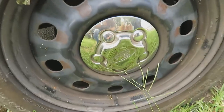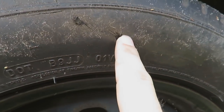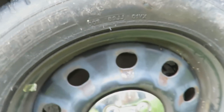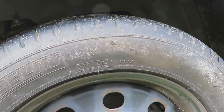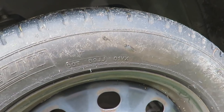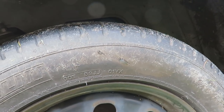Today I'll be popping these covers off. As you can see, there's some pretty healthy rust on these rims. This tire at minimum is probably not the safest thing in the world, because that's a pretty deep gouge. If you drive around, the tire gets hot, the air inside expands and puts pressure on that. If it expands and contracts enough, that crack is going to get a little deeper each time, and it will eventually blow the sidewall out.